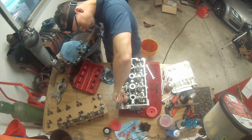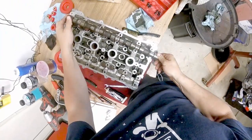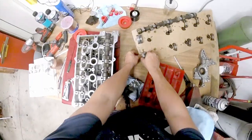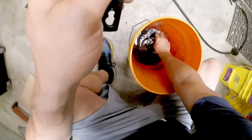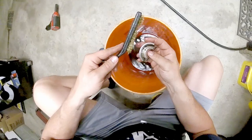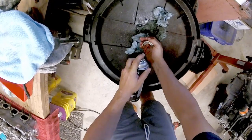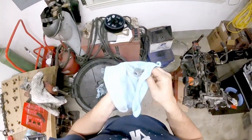Before placing the cam, use plenty of assembly lube on all the bearing surfaces and the tops of your lifters too. Before we install the bearing caps, I want to be sure I pick them up in order one at a time and clean all of the old sludge and deposits off of each one. I'm going to use my brass brush and the kerosene bucket and just brush everything off — again, we're not reshaping anything, we're just getting rid of the dirt. Blow it off with brake cleaner, dry it off with your microfiber towel, and then use a little compressed air to get all the lint out.